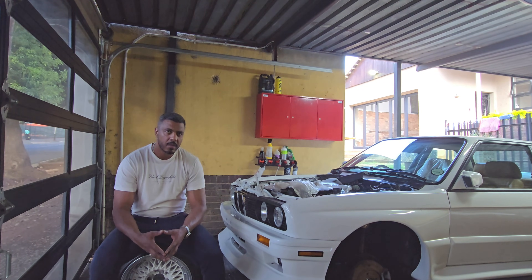The other aspect that gives it its torque is the single overhead cam design. Its simplicity makes it a lot more torquey, but less free-revving than the dual overhead cams produced in later models. Another aspect that makes this car so torquey is the flywheel — it's extremely heavy, and a heavy flywheel will generate more torque at the bottom end of the rev range.